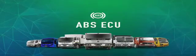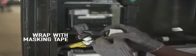ABS ECU. To protect the ABS ECU from damages, the connector should be removed. It has two connectors, big and small. To remove the connector, press the notch, remove the connector and wrap it with masking tape. Repeat the same process for the other connector. To refit the connector, place the connector on the ABS ECU, press the notch and push the connector till the notch is firmly locked in its position. Repeat the same process for the other connector.